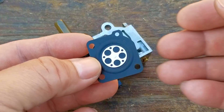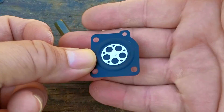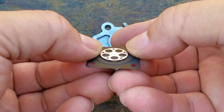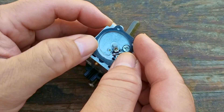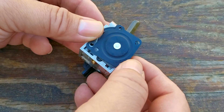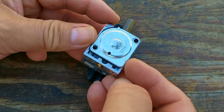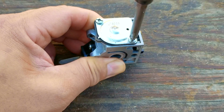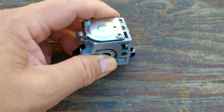Here's the metering diaphragm I'll be using for this carb — the most important part is that the stem in the middle is the same size as the one you're replacing. The stems can either be long or short, and this one happens to be the shorter one. There should be a link in the description if you're interested. When replacing the diaphragm, make sure the gasket is installed first, followed by the diaphragm, then replace the metal plate over it. If you don't want to go through the hassle of servicing a carb, or you've cleaned one already and it still doesn't run correctly, the other option would be to simply replace it.